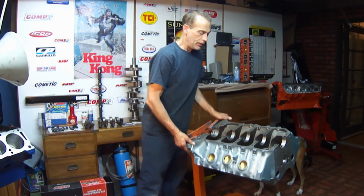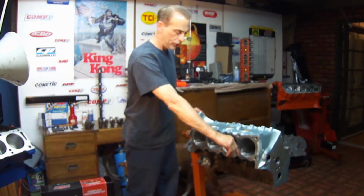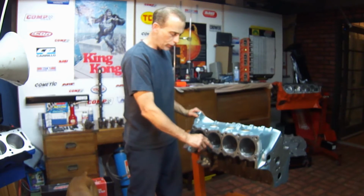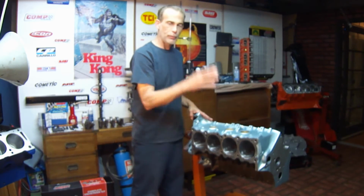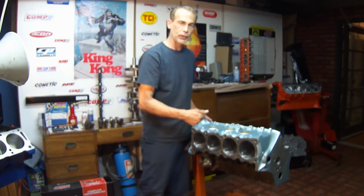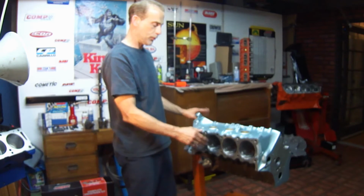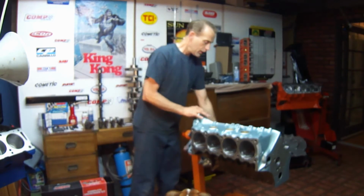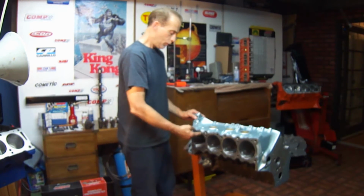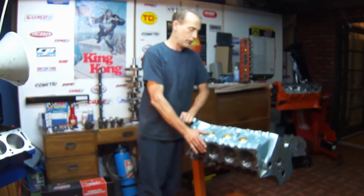After that's done, I take an alcohol wipe and I clean out all the cylinders. Because if you look at the cylinders, when they're honed, there are peaks and valleys, and if you put a little pressure, you can get it to be dirty when you pull it out. So you definitely want to clean it. You want it as clean as possible before you start. Then I coat them with a liberal coat of WD-40 and a nice clean terry cloth rag to clean it.